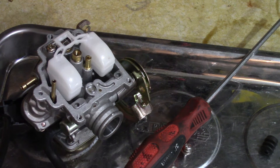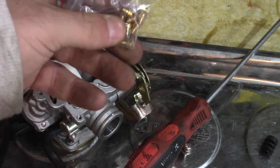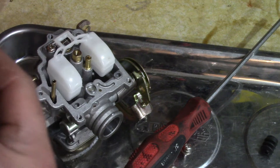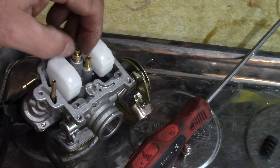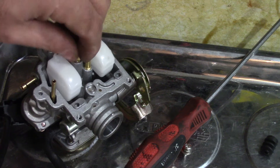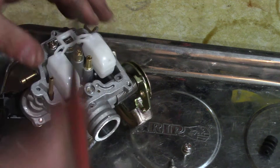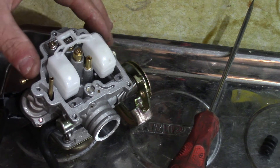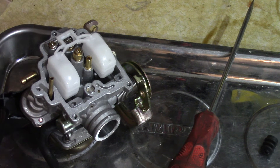I took a close look at it — that stock jet was a 75, and I have some other jets here. These are Glaxial, that's the brand name. They're sold on Amazon, and I'm just trying to put in an 80. I want to make sure it is an exact fit. So that'll go in there nicely — perfect. The idle jets are going to be much smaller; I don't think I have any of those. But that's how you'd modify this closed-off carburetor.